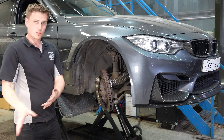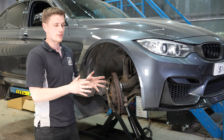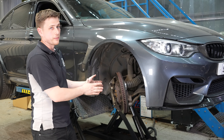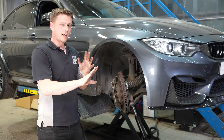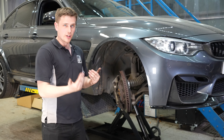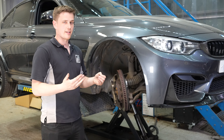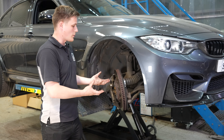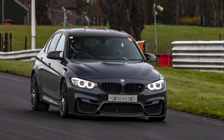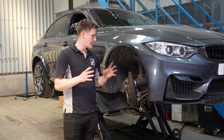When we'd fitted this kit, we headed back to Oulton Park for a track day with some customers and friends, gave it hell all day in perfect conditions, and we were blown away by the difference the cooling package made. The big difference was we still started getting a slightly spongy pedal after some really hard stops, but as soon as we got to the end of a straight, the pedal was fully back to like new — such a massive difference. We could do lap after lap, and every time the brake cooling package would cool the disc down to a point where the pedal feel was completely back to where it should be. We've got much better performance throughout the day, we're no longer warping discs, and we've no longer got that pedal fade — both issues are now completely removed.